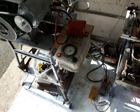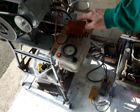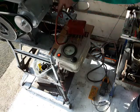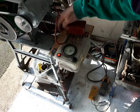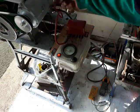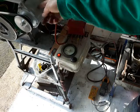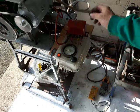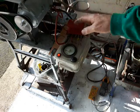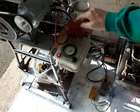So that is a good Dynastart. Another way you can test these, if you think you've got a suspicious regulator, is to disconnect the two wires — the DF wire, which I've got in yellow, which is the forward small one, and the D-plus wire. You can put an earth between the chassis and DF while it's running, just for a second, and measure the output on the D-plus pin. That should go to about 16 volts if it's revving up, and that tells you the Dynastart's okay — it must be the regulator.